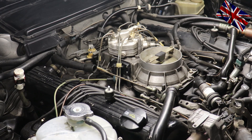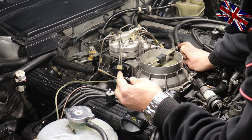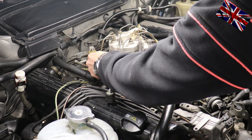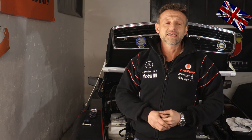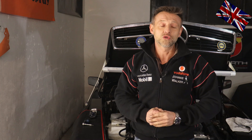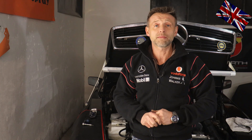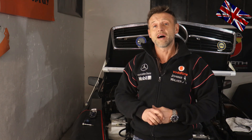The fine-tuning jobs are done. The new Bosch potentiometer is working perfectly — just spent 200 euros on it. We now place new covers on the screws to prevent corrosion. Task completed, job done. No academic education needed to get this job done. Easy access for a component change with an M117 engine in an otherwise completely cramped engine bay. If you have a car with an M103 engine, there is a high-pressure fuel line to be removed first, and a fuel pressure accumulator — therefore no smoking while doing this job.